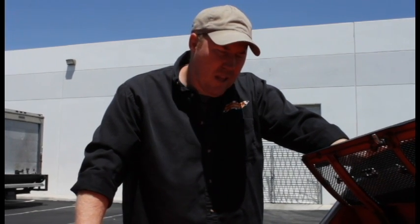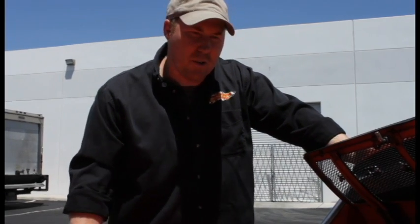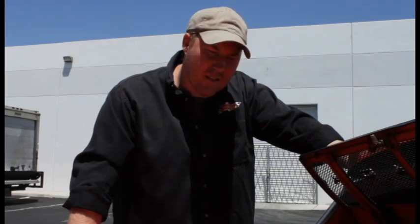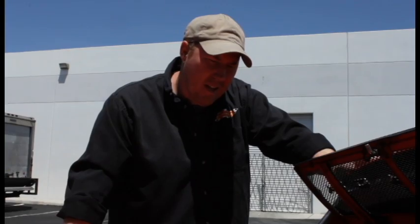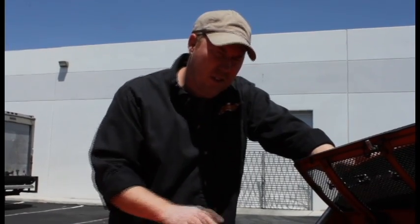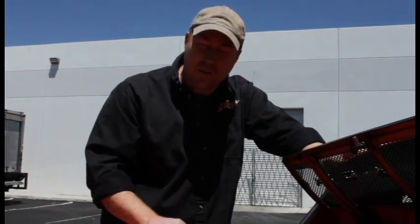All right. I'm sure some of our customers would love to know more specifics about the small block that you have underneath here. Give us the numbers, if you wouldn't mind. Absolutely. This started off as a standard ZZ4, which is a great baseline performance engine for a 914. Really close to the limit if you're running a standard 914 gearbox. Makes for a really fun, fast car. By going with the Boxster S tranny here, we're able to increase the power a bit, so now we're probably 420 horsepower or so. You've got AFR heads, an upgraded cam, different intake, and Edelbrock's fuel injection system.